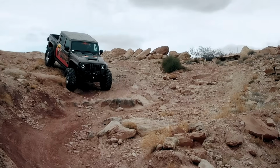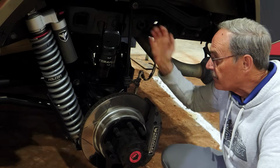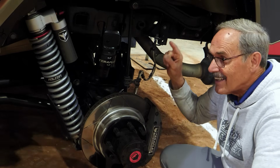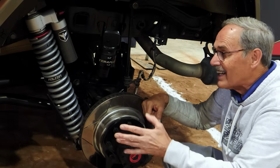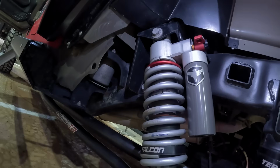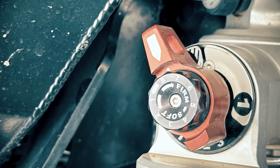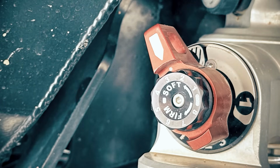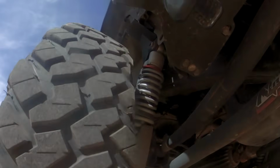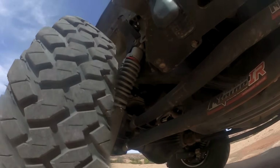We did the coilover on this one, because you can get that 16 inches of travel with a regular 3.5 TeraFlex Falcon shock on it. But over the years, we just keep modifying this bad boy, and it's the full meal deal this time. We're talking coilover shocks on it. Still has the full adjustability, 3-position up there with the micro adjustment available to you in the 2nd position. But the quiet, no threads on these things. They're just dead silent. They travel up and down.